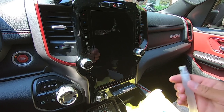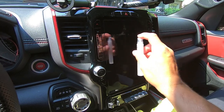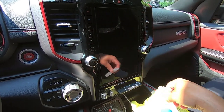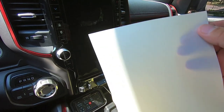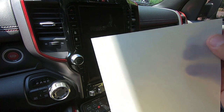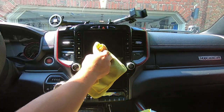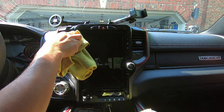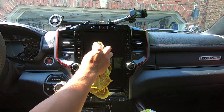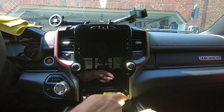Open up the cap, make sure your dish detergent solution is all mixed up, and we're going to start spraying. We basically want a nice even layer of liquid on the screen itself, then we'll peel the matte film off its backing and install. Let me get the camera set up and we can do this in real time. Let's get those last few dust particles off of there — some of the liquid you spray will carry that stuff out anyway.